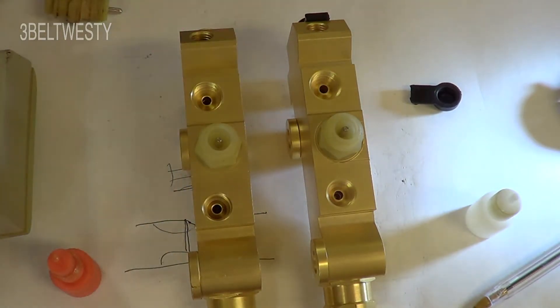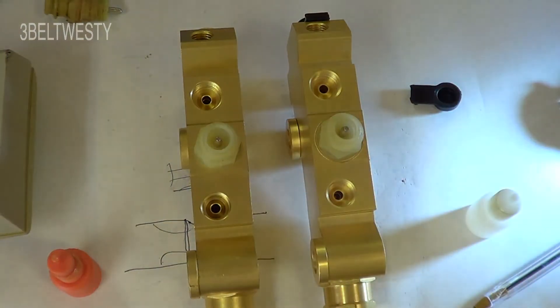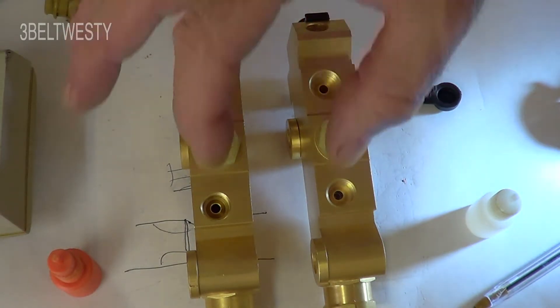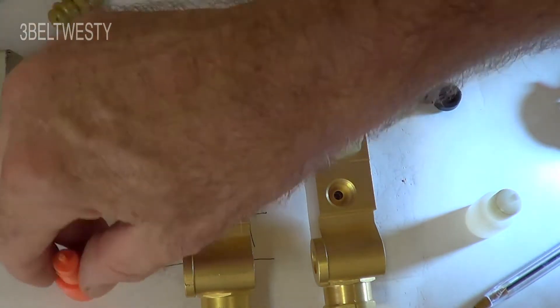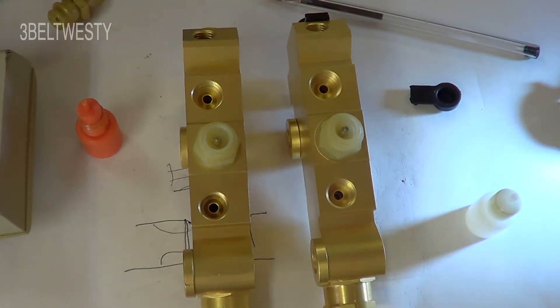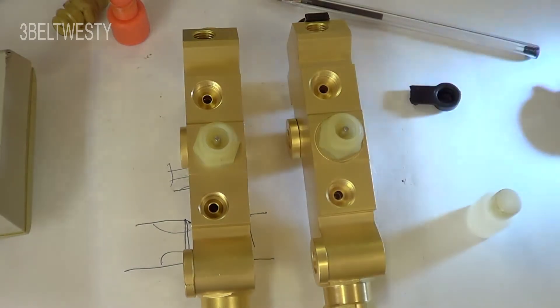One of my items to do is take one of those apart. If you had a pressure gauge you could pressure one side and not the other to see the force it takes to get the piece to slide. Some people say that when you bleed the front and get the spool to move over because you didn't use the tool — I bled the front before and never used this tool, but I didn't use a pressure bleeder. When I used a pressure bleeder, that's when it locked off on the one in the car.